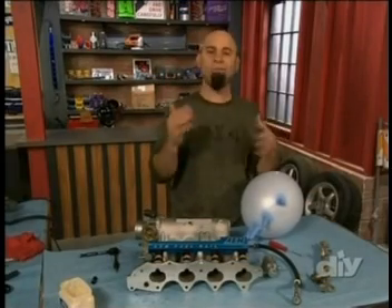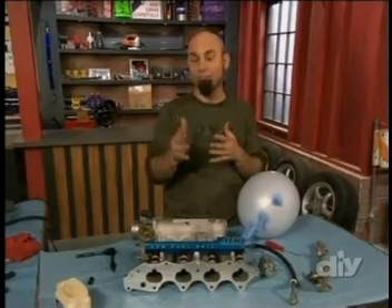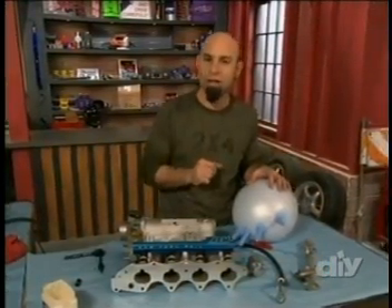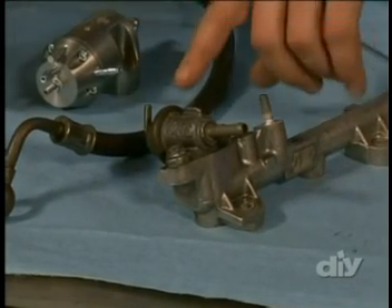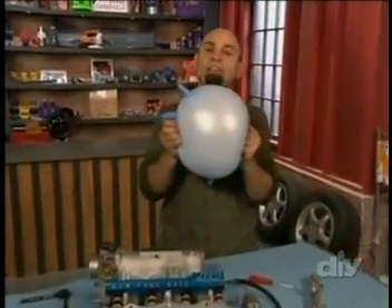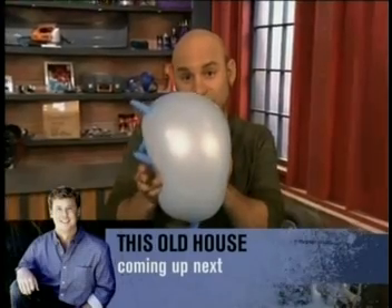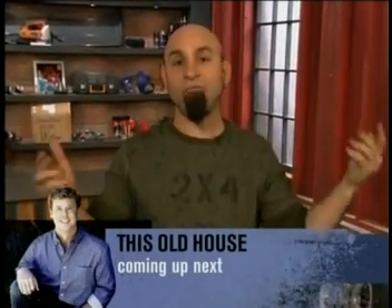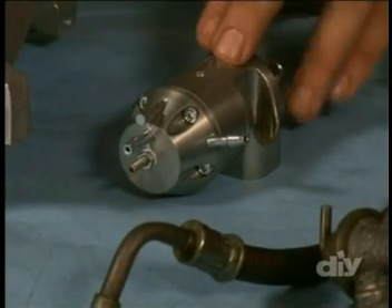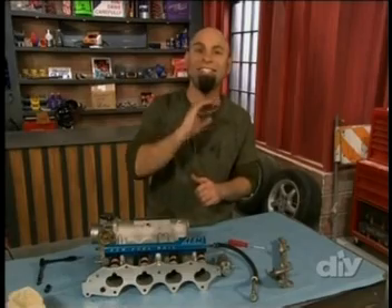The fuel pressure regulator's job is to react to driving conditions and keep a constant pressure at the fuel rail. A stock Integra runs around 30 psi at idle, but with all these new mods we're hoping to run around 38 psi at idle. The stock FPR is not adjustable, so I'm going to replace it with an adjustable fuel pressure regulator. The problem with the old style is the rubber diaphragm — it has a lot of flex, making everything slow to react, and under boost pressure it can pop and flood the engine. The answer is a new redesigned fuel pressure regulator that uses a metal piston instead of that rubber diaphragm design — instant reaction, more durable, and install is a snap.